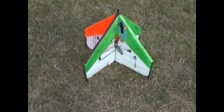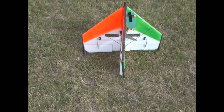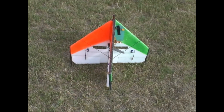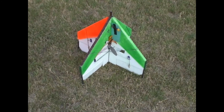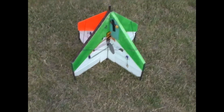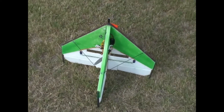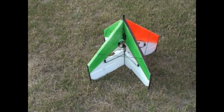We've got it set up so that there's a top and bottom rudder. You can see the top rudder and the bottom rudder. We've also got a program mix so that all four of the surfaces will work as aileron. Added some carbon fiber supports towards the top, and it also has a three-axis stabilizer that we're still experimenting with. The prop is a 10 by 3.8. Servos are Hobby King 900s, and we've been flying this with 1,500 to 1,600 mAh 3S batteries with a 30-amp ESC.